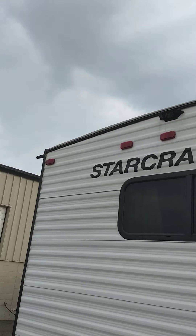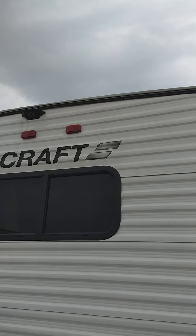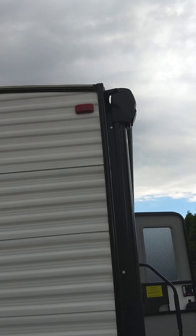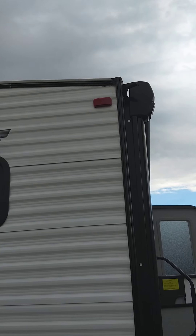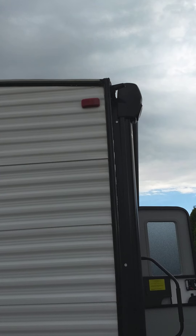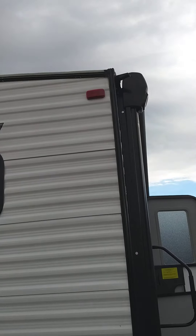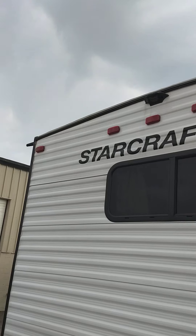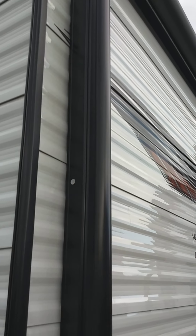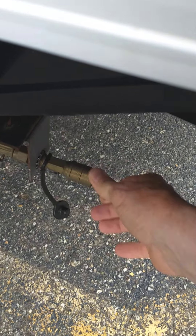While we're looking up — you have to inspect the roof of this trailer and every other trailer three times a year. You're going to do it in the spring, the fall, and once in the middle of the summer. You just go up on the roof, walk around, and look at all the seals. The roof is sealed with a lap sealant called Dicor. When you see separation or cracking starting, you need to have it taken care of. You've got to do it three times a year to protect your investment.